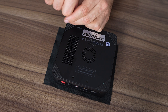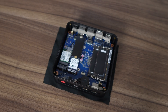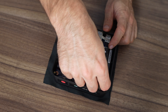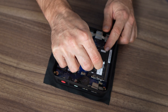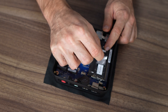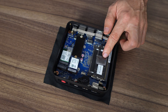Pretty straightforward to open — four screws, lift the lid, and then another three screws to remove the SSD and RAM cooler. While it does have dual 2280 Gen 4 X4 NVMe slots, this one comes with a 2230 drive with an extension adapter. That's not a problem, but what is a problem is that they've bundled this mini with DDR5-4800. The 7840HS supports up to 5600 megatransfers, and this is the first mini PC we've come across to go with slower RAM on this higher-end Ryzen chip. We'll see how it affects performance against the Boss Game M4 Neo with the same CPU.